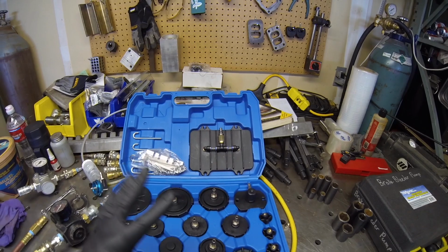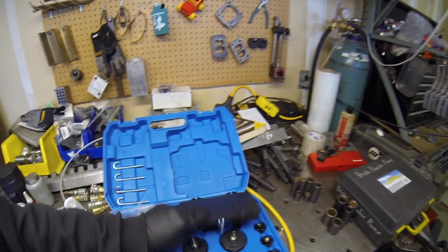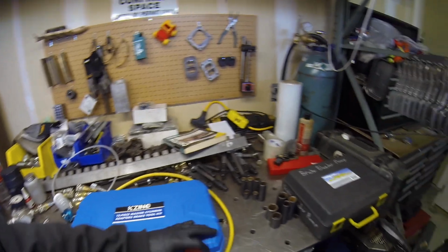Basically what you do with this setup is you pressurize the master cylinder, just barely though, from what I've been reading. And then you bleed your brakes. So you put a little bit of pressure on the master cylinder and then you go around and bleed your brakes. It's just like someone's been pumping the brakes, but someone doesn't have to keep pumping. It's just got constant pressure on the master cylinder and you just go around and bleed the brakes. Obviously you want to make sure you don't run out of fluid when you're doing it like this, just like any other way of bleeding it. But I've also read too, I'm gonna go a little extra and put a little strap around the reservoir on the master cylinder because it just kind of presses and locks in.